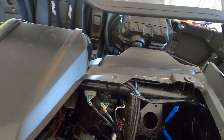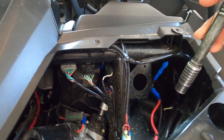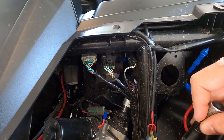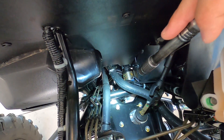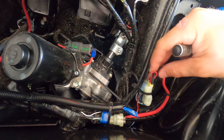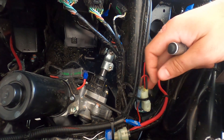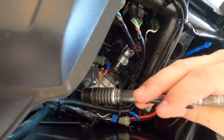Honda, like I went over in an overview video, was nice enough to include factory cables that could support a winch. The Hess four-wheel drive kit actually came with this plug right here, and this plug plugs into the factory blue connector right there, which is key power. It has another plug that plugs in down here on the side of the differential, which is super easy — it's an inline plug. Hess includes a piggyback plug for additional power, so this is actually a key power wire out of the Hess plug that uses the original wire. I ran that over to here.